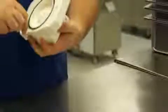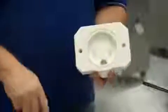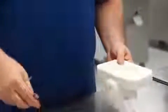Finally, on the back side of the door is 1 large O-ring. It will also need to be removed for cleaning. When cleaning the dispensing door, you will want to brush out any and all holes. You will want to remove, clean behind, reinstall, and lube the exposed portion of any O-ring.